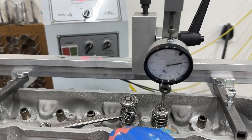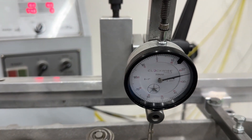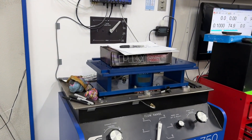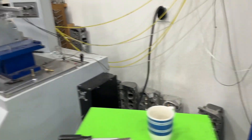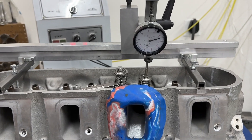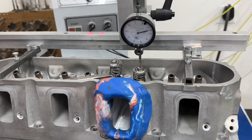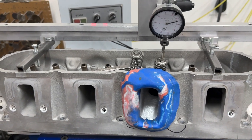You can see it actually does 350 in the earlier lift range, but from 650 lift on it's actually gained a little flow. It looks like it backs up at 675 - that's where it loses flow. It's not so much the port; it's just the LS design. On my Superflow bench - which would show about 8 CFM higher numbers - I have a swirl meter, and if you watch what's happening, it's not because the port speeds are too fast. There's no swirl at all until about that 675 point. At that point the valve opens enough for the air to start turning, and once it does, it's blocking part of the flow path, causing it to back up. Then as the valve opens more, it starts climbing back up again. That's just what LS heads do.